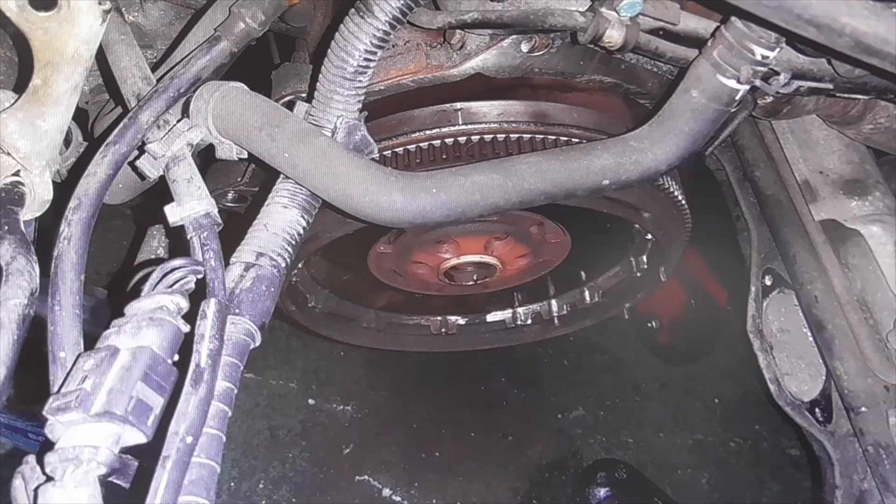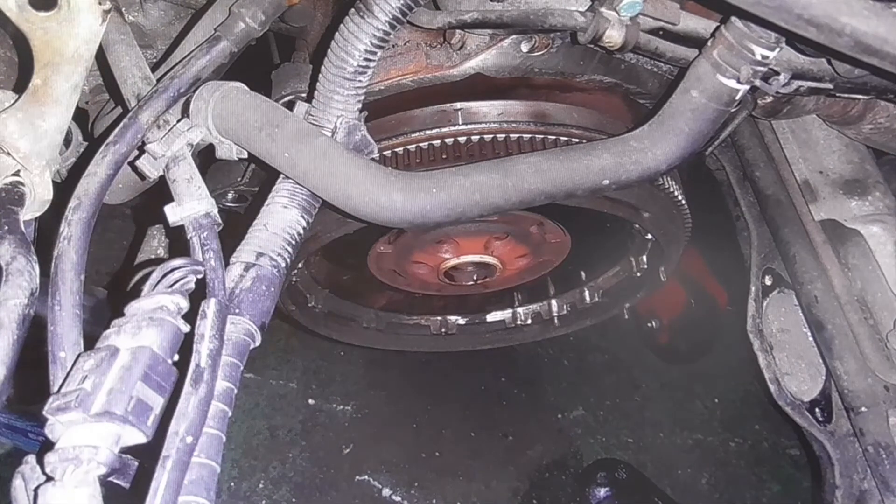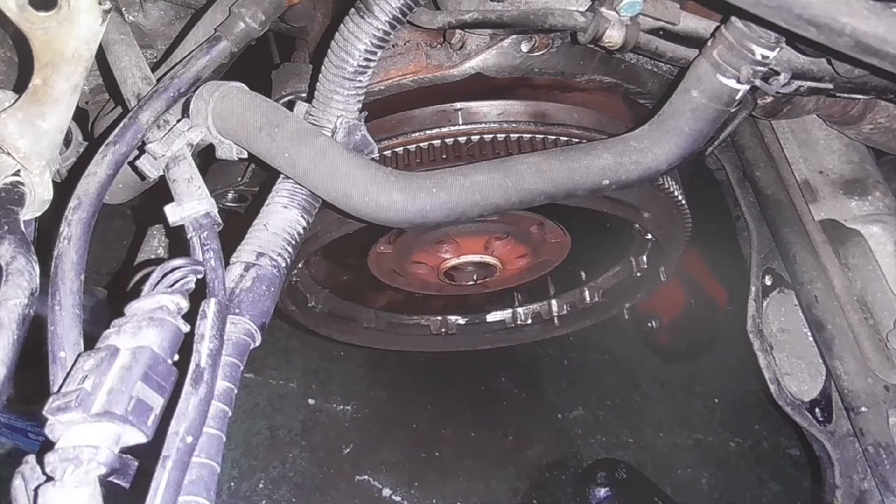This vehicle is 18 years old and has come to the workshop because it was vibrating a lot, tapping on the clutch. When disassembling, we have seen that the dual mass is burst — you have to change it of course. When we gave the man a budget, the total came out to almost 700 euros.